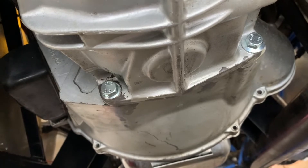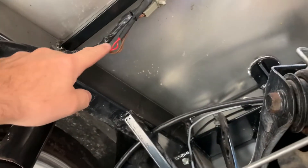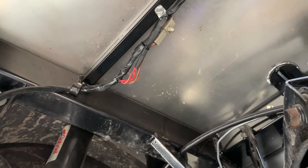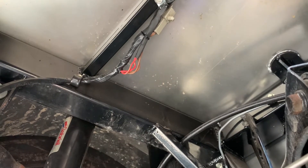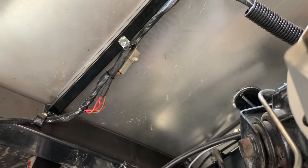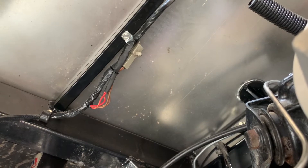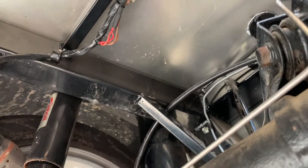Alright, here we are in the back. This is a little bit of wiring I had to fix. This wire here — the red with green, which I believe is a turn signal wire — it was just hanging down with an open connector dangling. That seemed a little dangerous, so I used some shrink wrap, squeezed together the end with adhesive lining so it's getting sealed, and then zip tied it up to the rest of the harness. Those two things are up and out of the way, so that's all I wanted to address back here.